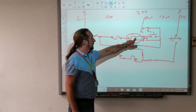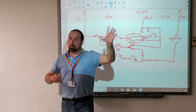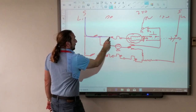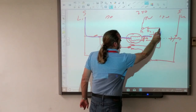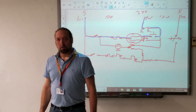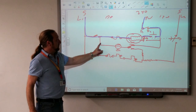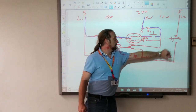Here's my motor. I've got to get this power to my motor and to neutral — just like that light bulb, line one to neutral. So we have to look at the circuit. It comes through here, through here, comes through the motor, through the start switch, and out. That is the circuit to get power to my motor. Do I have to check this? No. This? No. This? No.